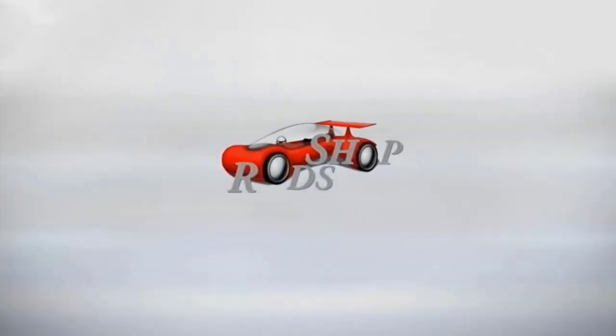Have you changed out the radiator on your motorcycle and now it seems to be overheating and you're not sure why? Let's look into what causes that. In this video, we're looking at a DRZ 400S, a Suzuki 400 street and trail bike. The customer changed out the radiator — the right radiator was leaking, and these are a two-piece system, one on the right and one on the left. After swapping it, the bike started overheating and the temperature light kept coming on. What it really amounted to was the air just didn't get burped out of it.